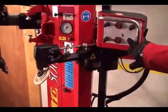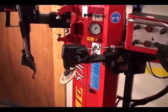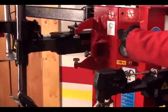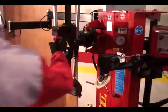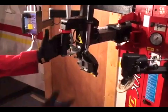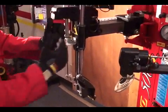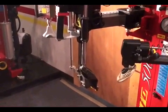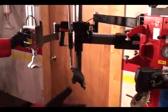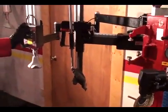The last button on this unit is the switch for the leverless system. When I flick this, you can see on the mount head the finger coming down or up — the wing, the switch, the springs, the arm inside. With the trigger, the post goes up and it's free to move. Halfway, it starts coming down, so I can just hold it, place it against the rim, and when I lock it, it goes out and up a couple of millimeters so I never touch the rim. After I set the bead breaker and the mount head, everything will stay in the same position for the next three wheels.